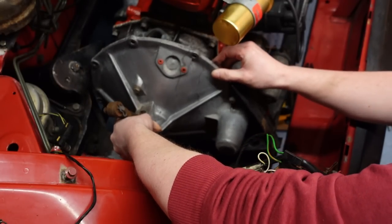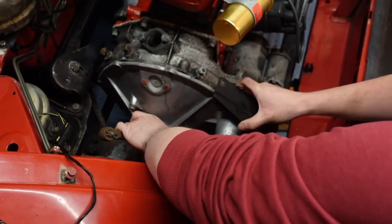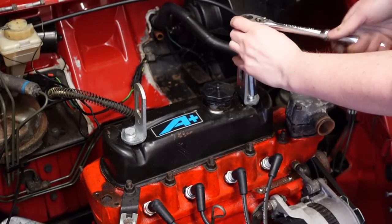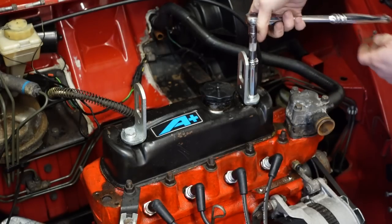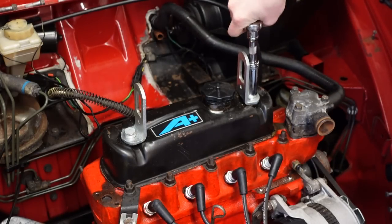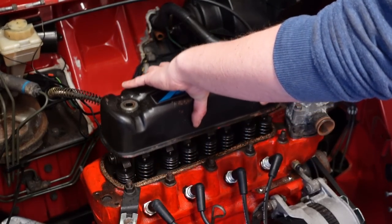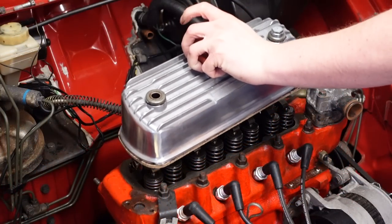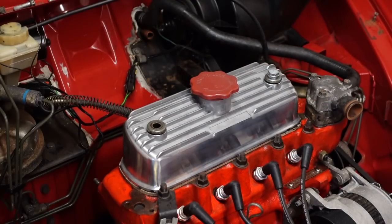Can you tell I forgot to clean up the transfer casing? Next on the to-do list is the rocker cover, because while this used to be perfectly serviceable, when I bolted the engine lifting brackets to it I tightened them too much out of fear, warping the cover, so we need to fit a new one. Fortunately, because A-series engines are popular, I bought a reproduction MG Metro rocker cover - and doesn't that just look spectacular.